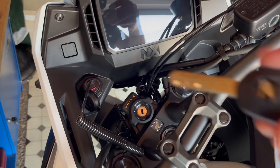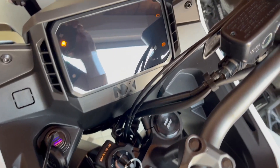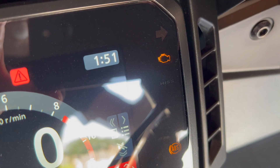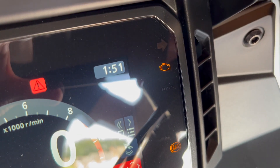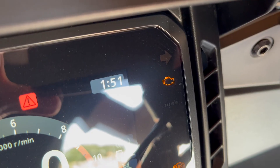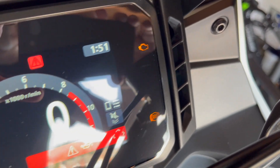So here we go. I'm now going to show you the issue. I've just turned the ignition on and you can see that light there is on and it shouldn't be on even at this point. When you start it, it certainly should go out. I've tested this twice — it comes on for me using E5 fuel, not E10, and it comes on after about a hundred miles.